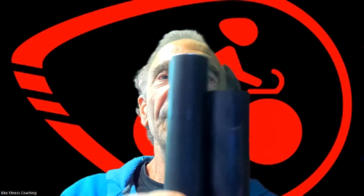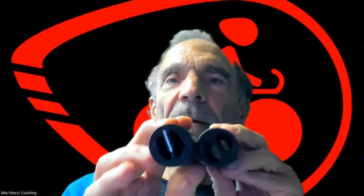This would be the top. Let's talk about the quality of the steer tubes. I have the steer tube cut here — the fork crown comes through and down here. This is the Orbea, and this is a Giant TCR Advanced. This is the part most people don't see — this is where the fork crown comes out and the front wheel is down in here. If you look at the Orbea, there's about three millimeters of wall thickness of carbon. That's the whole thing holding the bottom of the fork to the steer tube.